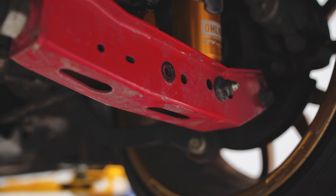I almost forgot that the Faction Fab kit comes with an additional brace due to the fact that it's a thicker rear sway bar — it's going to need a little bit more bracing than your factory sway bar. This mounts to the lower control arm mounting point and this lower bushing mount point. So I'm going to undo the 12 millimeter bolt I installed earlier and the 17 millimeter nut, then we can get this new brace installed. Faction Fab has included new hardware as well since the original hardware will no longer be long enough for this new brace.